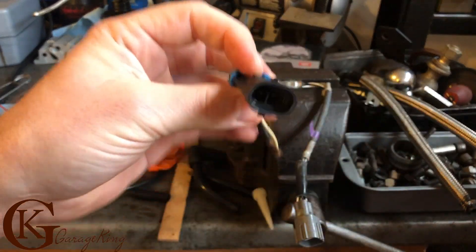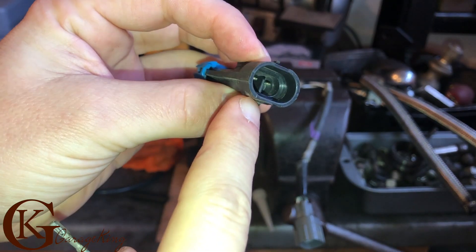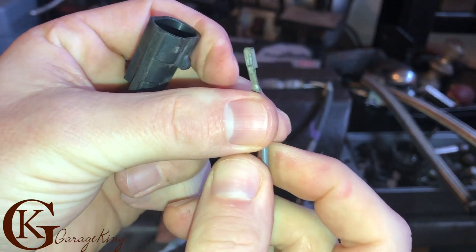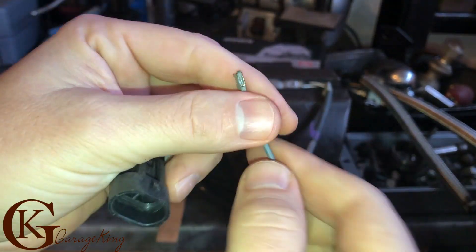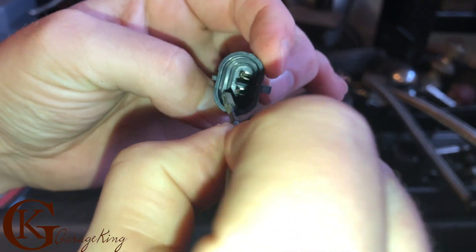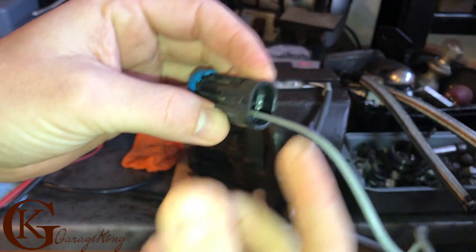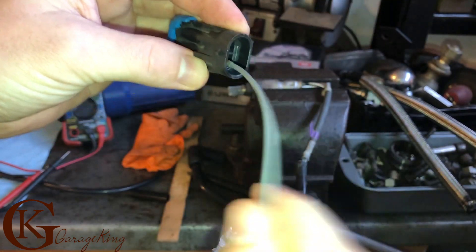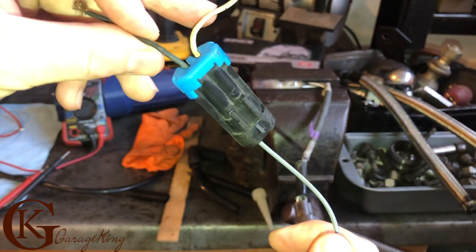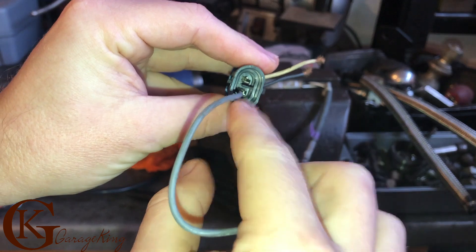Similarly, say you want to check an ABS sensor — this one was for ABS. You can see there's some light there, so how are you going to connect those connectors? Well, I made up these little small things you can get at your automotive store. It's the female end of the connector — you can buy a lot of these and crimp them on. Now I can go inside and connect it, and it's actually connected. So you can put your meter on this one; if you're checking for continuity, attach an alligator clip connected to your multimeter however you want, because it's really hard to get alligator clips into a deep connector.